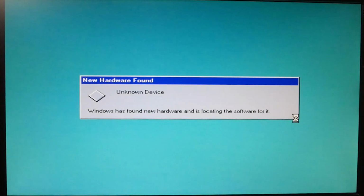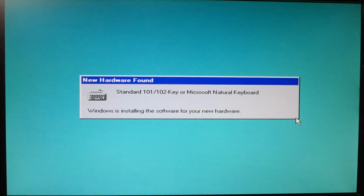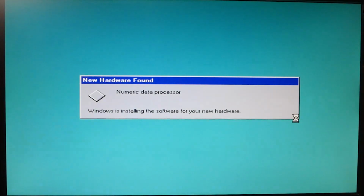It's so eerie that there's no hard drive noise in this old machine with that compact flash, and it's so fast. Yes, with the wear leveling, and as many writes as Windows 98 and 95 do, you're going to have to shut off the swap file access to the drive. That being said, it's just like picking up this new hardware for this Gateway, incredibly fast. It's unbelievable. I don't know if this has Ultra DMA 33 or 66. I know it's not 100. I'm pretty sure it's not.